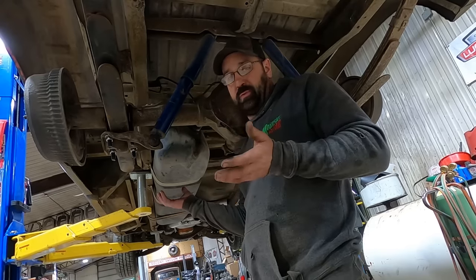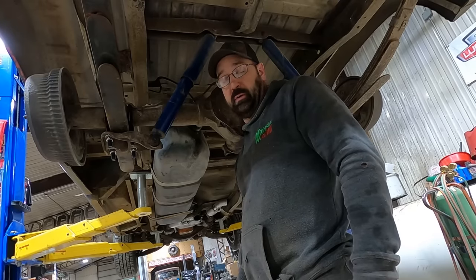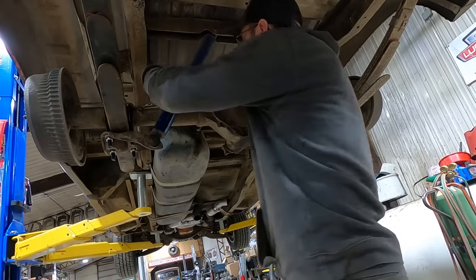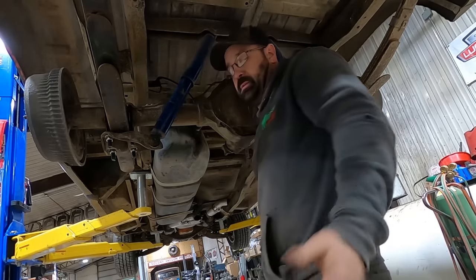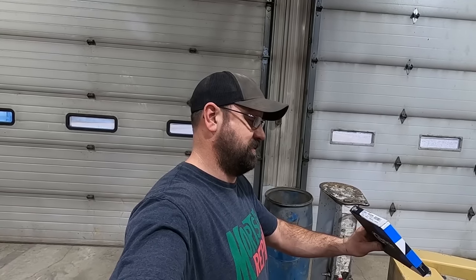It's like an 84-83-2 Pontiac Grand Prix or 67 Rambler Ambassador Rebel SST. Super Sport Touring. Who knows? It looks like it's just your standard rubber brake hose with a T at the end, but it's also got the hole for your breather. Doesn't look like anything too crazy. Sure enough, did a little digging, found this Centric part number for a 67 to 72 Ford F100 rear, almost the same thing. Length, thread pitch, all that stuff. She's gonna work just fine. Part number is 150-65304, country of origin, China.